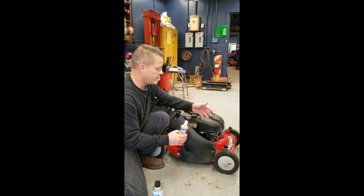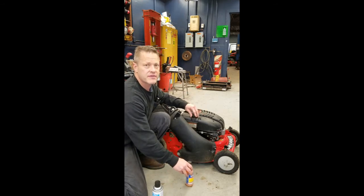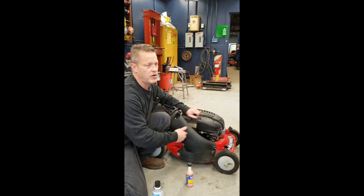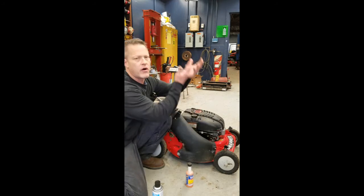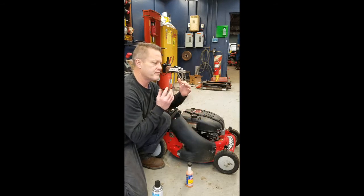But what I like to do is, if possible, get the engine to run out of gas. Use up all your gas. Let it idle, whatever you got to do, like mow the lawn again. Let it run out of gas. And then give it a few extra pulls to try to start it. And that helps draw out the mixture that's stuck in your main jet.